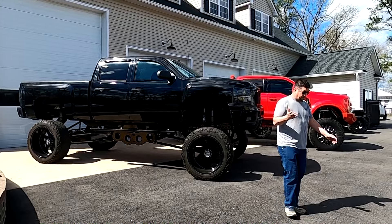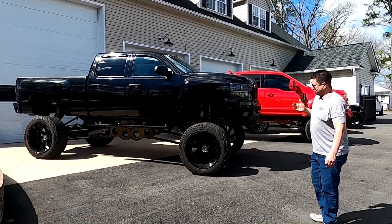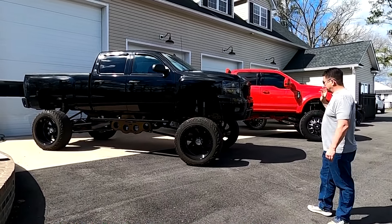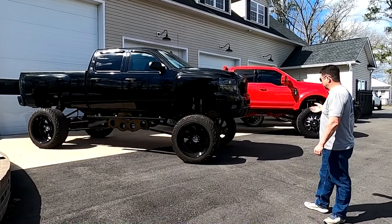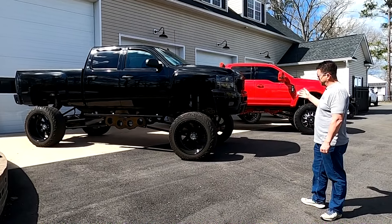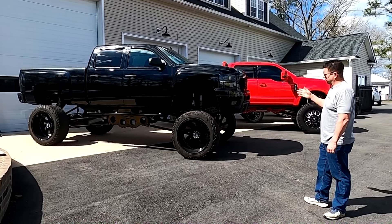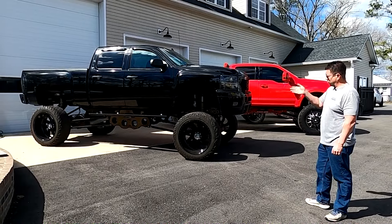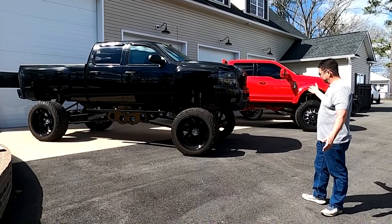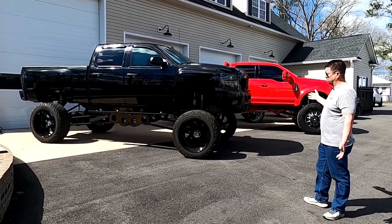We don't knock him — he does some cool work. Four-link solid axle conversion, SAS conversion — that's solid axle suspension conversion — face plates, overlays, big heavy-duty cross member, coilover front, coilover back, and over the top of 40-inch tires. This truck would honestly run a 44 with no issue.